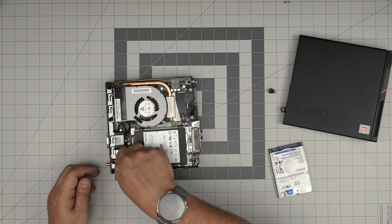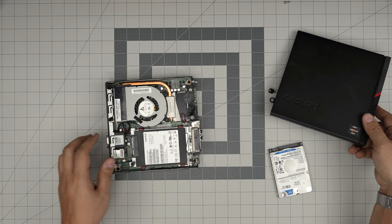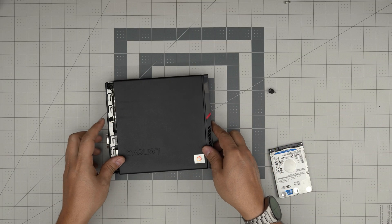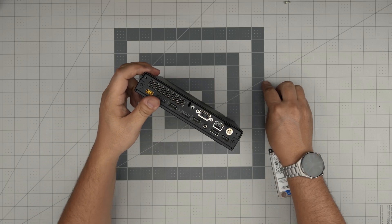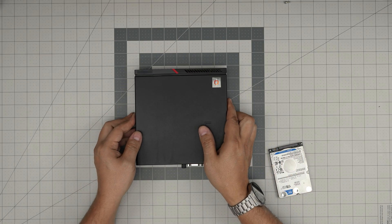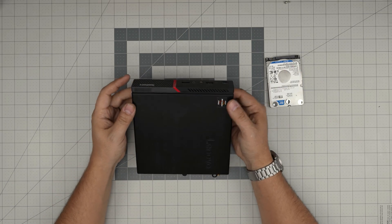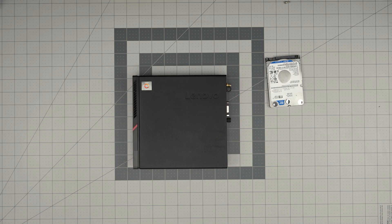All you need to do now is install your Windows on the NVMe and format the SATA drive as a secondary storage partition. Grab the top cover, put it down in an offset position, slide it back, and put the back screw in. I hope you guys liked this video and it helped you out. If you want to support the channel you can click like and subscribe - I'd greatly appreciate it. If you have any questions or requests feel free to leave them in the comments. Thanks for watching and I'll see you guys in my next video.